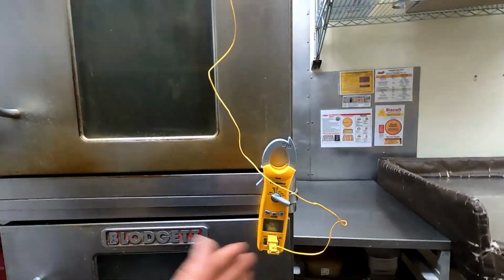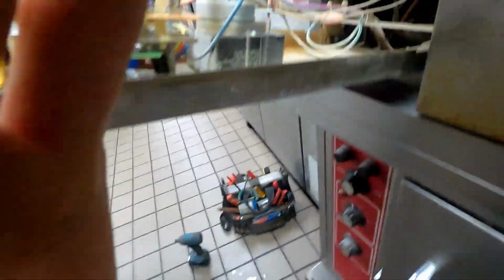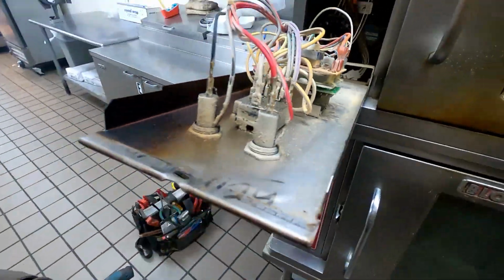We want it to be a max of 400 because they're having trouble with it burning food. And yeah, the ohms reading was close enough that we were able to just get rid of the problem by adjusting that a little bit. Should be good to go.